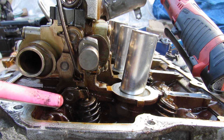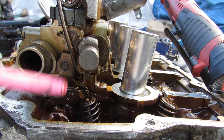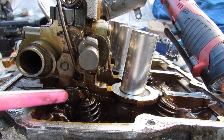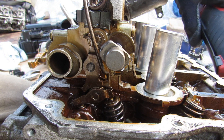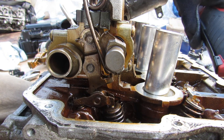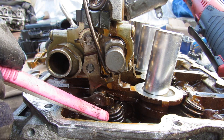In reality that would reflect an almost closed throttle because you don't want too much air going into the engine at idle. As I rotate this eccentric shaft, it's going to change the angle of these two arms and thus push the valve down even though the camshaft position hasn't changed. And you can see at that position it presses the valve down to its maximum open position.